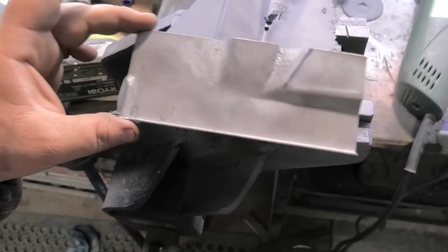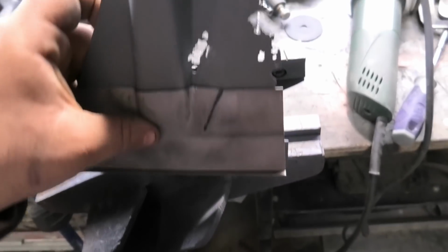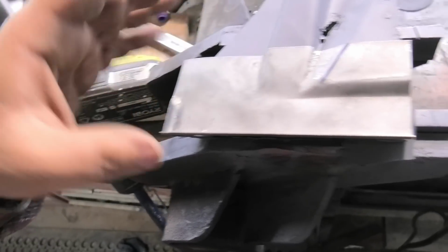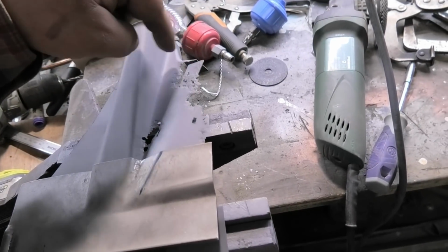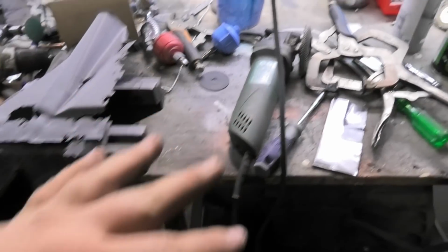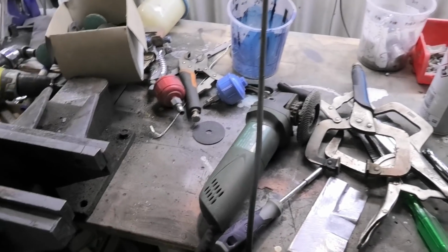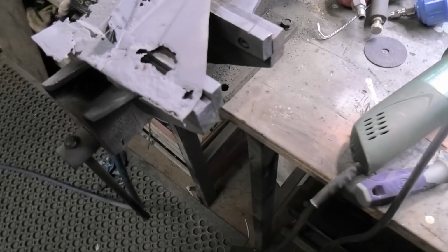So that's going to go there. Tomorrow I'll put my little recess in it. Well, that one's got there. Got my fold, so that'll go there. Matches up fairly well, and I'll weld that in tomorrow, and then I'll trim that edge down a little bit, and then I'll do my next piece, which should be way simpler, which should be just up there and across, and I'll do that last, I reckon. But tomorrow we're going to attempt to get this all together and done in the next video, and have this welded back into the car, and potentially by the end of the next video we have the first piece of the puzzle in. But you just can't leave it like that.